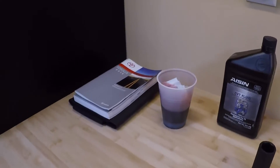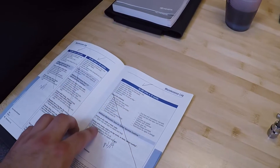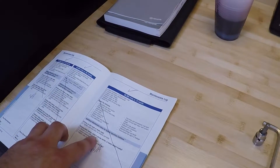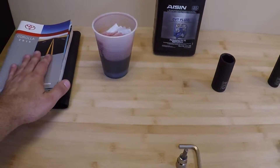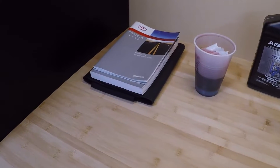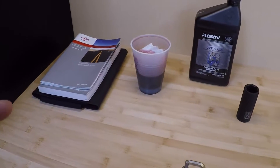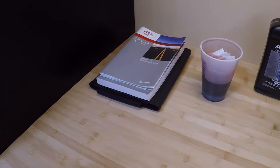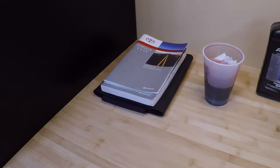If you've looked at your Toyota Corolla maintenance guide, you've probably seen on page 45 under 60,000 miles, under additional maintenance for special operating conditions — driving while towing, using a car top carrier, heavy loading — to replace the fluid at 60,000 miles. This is the only recommendation Toyota has. They don't have a recommendation for normal driving, which is what most people do. So some people have thought: if you're doing 60,000 miles of heavy driving, you could probably stretch to about 100,000 miles, which is when I had the dealer do my fluid initially. I've gotten everything from 'you're crazy, even 60,000 miles is too much, the fluid's toast by 30,000 miles' to 'you never have to change it — it's sealed for the life of the transmission.'